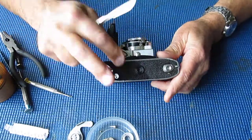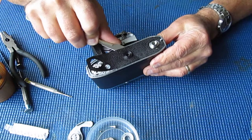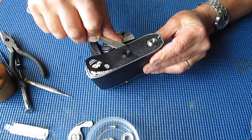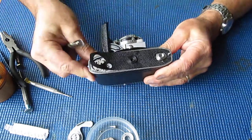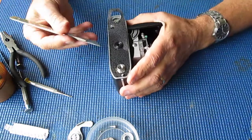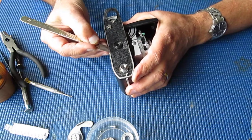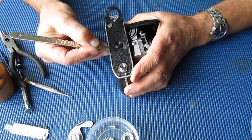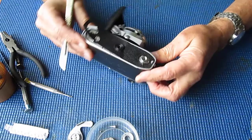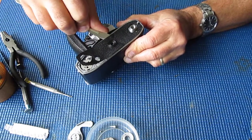Another thing to be aware of is that aluminium boss in the middle. It is aluminium and it's black anodized. It will show scratches. If you scrape up and down that with your scalpel in the process of getting the leatherette off, there'll be bright scratches on there. They can be disguised with a marker pen later if necessary, but better if you don't have to. Well, actually, we've just about got round that boss all from one end. That's quite good.